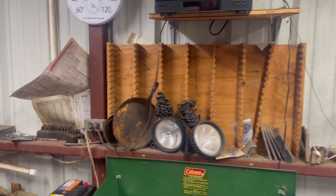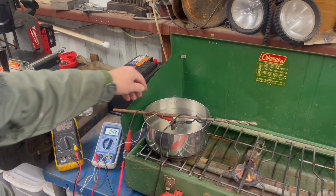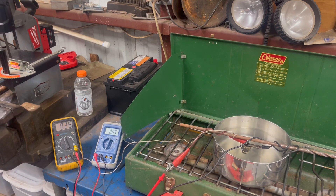Let's get you closer so you can see the readings. Yes, you can see 25 degrees Celsius. We have ohms, so let's move this over to the fire and see what happens. I only have a Celsius probe, not a Fahrenheit probe. That's at 28 — 28 Celsius is 82.4, 29 is 84.2 degrees Fahrenheit. When the beeping stops, that means we've reached the point where it turns off the fast idle cold advance.